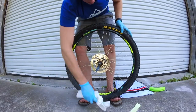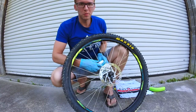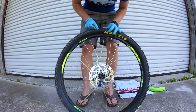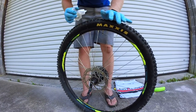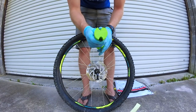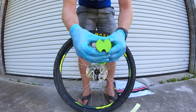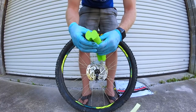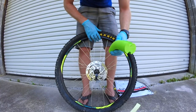The insert is on — that was a much easier job than what I've watched people do with the Cush Core. There's no air in it right now and it runs all the way up the sidewall. This gives it run-flat capability, and you can see it provides cushion coming down. It actually gets progressively more stiff with more compression, so it's not a harsh ride but gets harder on bigger impacts — which is awesome for protecting both the rim and tire.